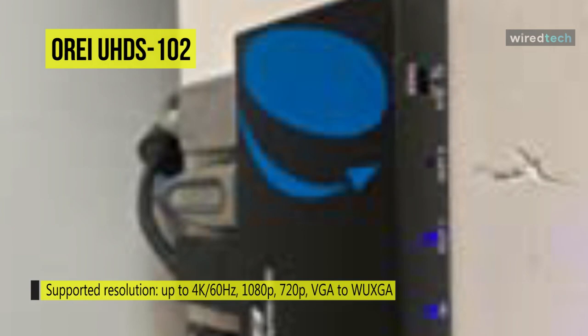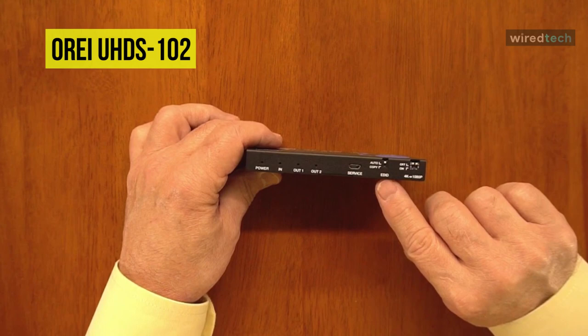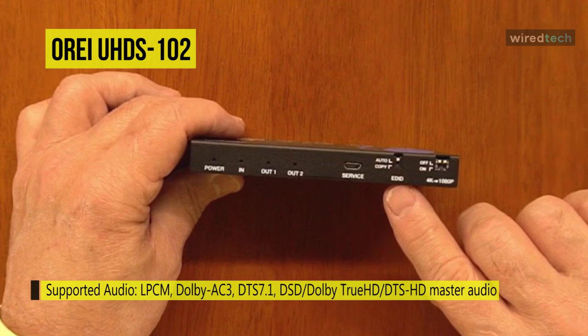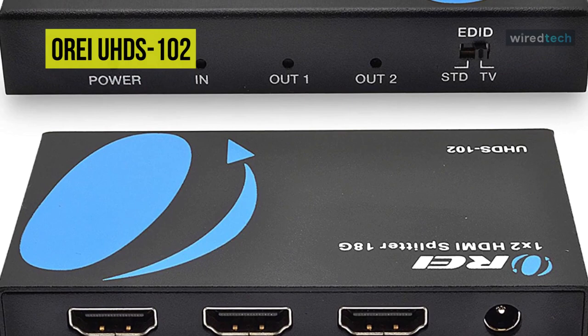Smaller, solid, and simple to set up and operate. Ideal for expo, conference room, auditoriums, bedroom, lounge, kitchen room, and lawn. Note that this HDMI 2.0 splitter will duplicate the source to two output displays — it cannot be used to extend a desktop for a PC. If the connected displays don't support the same resolution, the splitter will lower the output resolution to the next best resolution supported by both displays, and the same applies to the audio signal. We suggest using this HDMI 2.0 splitter with quality HDMI cables 30 feet or less.